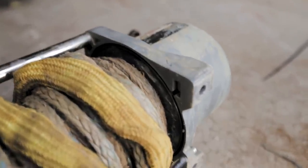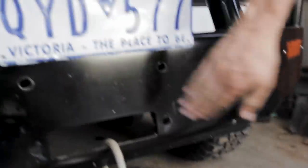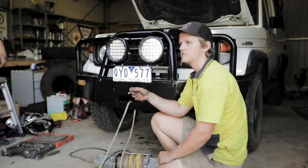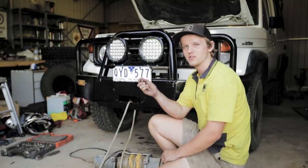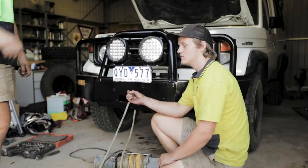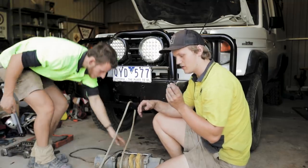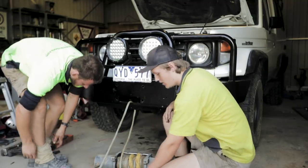If you've never put a winch in before, there's a little square nut that goes in there and then the bolt goes through that into the nut, which bolts it to your bull bar — pretty simple technology. The bolts that come with this winch — mainly because it's a cheap winch, like a $300 winch — aren't really that good, so in the future I'm going to get new bolts. For now we'll use the original ones, but you've got to be very careful not to snap them. Don't do it with a rattle gun — I actually snapped one doing it up by hand.